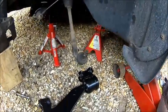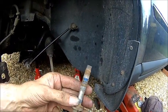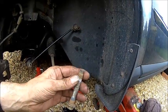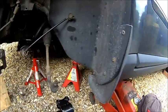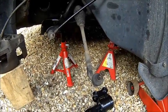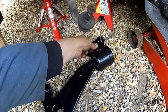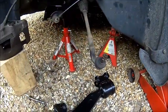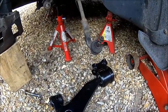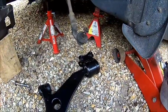They don't look like stretch bolts, but they are very Loctited. I don't have the bolts — it didn't come with bolts. Maybe this is stretching. We'll do it to spec — 60 plus 90 degrees — because before the bolt was already stretched. Should be fine.